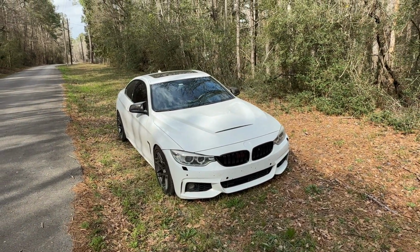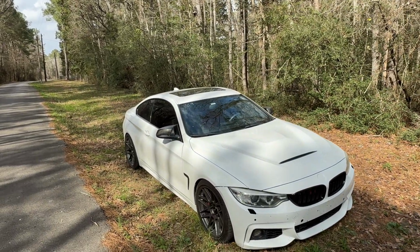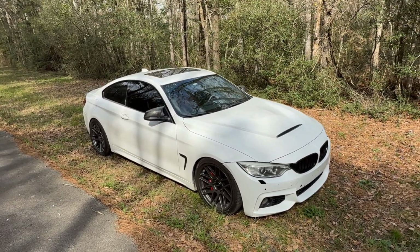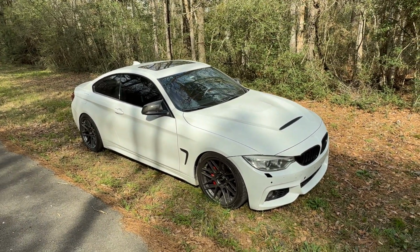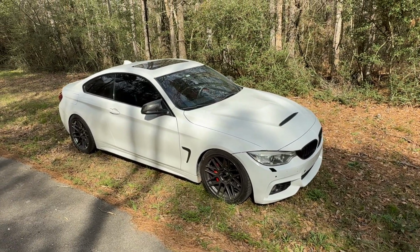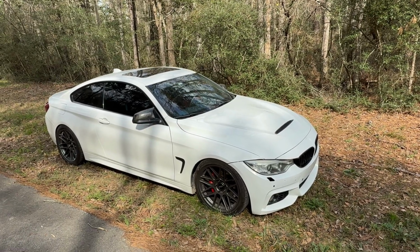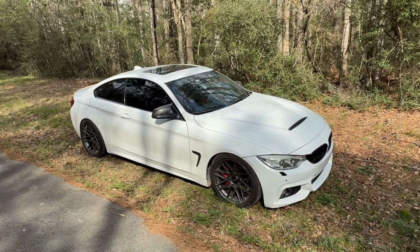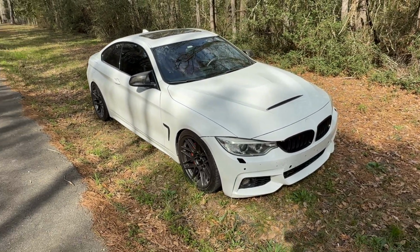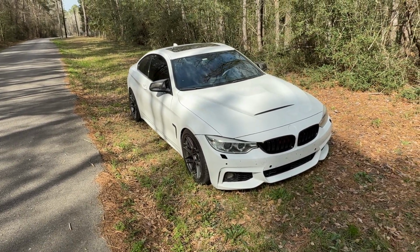So coming out of the turbo, the stock outlet, so from the turbo to the intercooler is stock. The intercooler itself is a MAD race version. That's going to be the largest one that they run. Highly recommend you do that. Skip all other intercoolers. Just get any race version, whether it's BMS, VRSF, or MAD. I think those three pretty much are identical, or they function the same, to put it that way. So just get whatever's cheaper. Coming out of the intercooler, I have a MAD charge pipe.